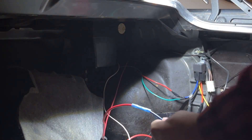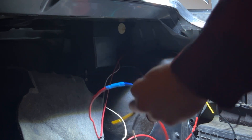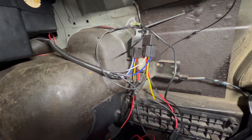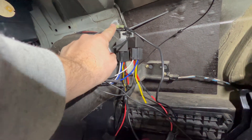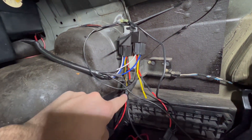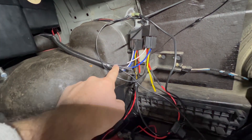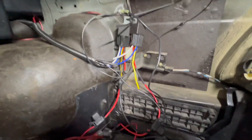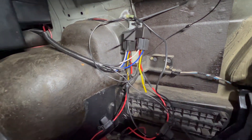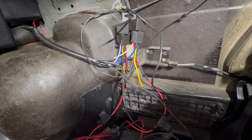Pretty good hold. Let's hit it with the heat. And that's on. Slide this over. This is what both of them look like all wired up. I use this as the ground up here. My primary fuel pump gets fully grounded in the cabin. My secondary fuel pump — I ran the ground wire down and hit it to the back battery. But as you can see, I still have the ground going in here and then on the relay as well. That is how it looks all wired up, and then it all gets tucked in so you don't see any of this.